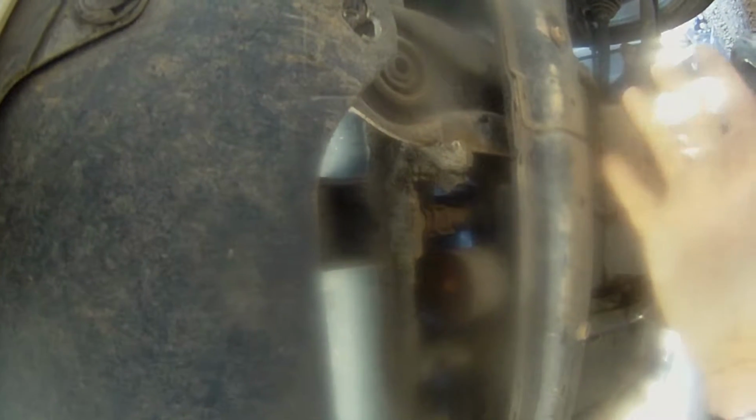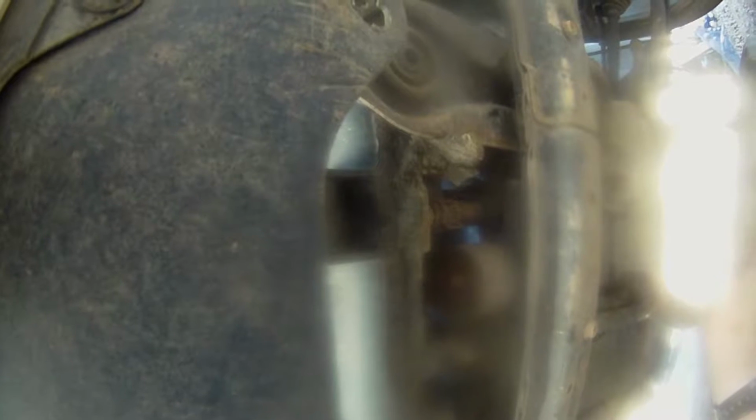Unfortunately, the way they put the clamps, this would have been really easy for me to do the way I wanted to, but the way this clamp is here, I can't get anything on it, really. I'd have to spin it around, and it's not cooperating, so I'm going to try the method I've seen done before. I will take this return hose off, hook another hose up, and we'll run that into the drain pan. Then I'll get the funnel ready up top, start the engine, let the old fluid drain, and keep adding new fluid till it comes out nice. So, catch you in the next video.